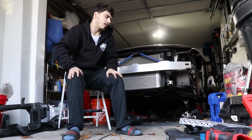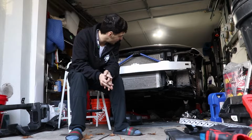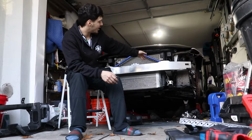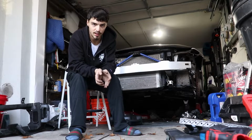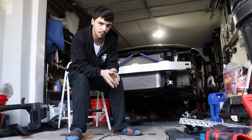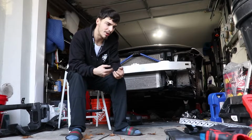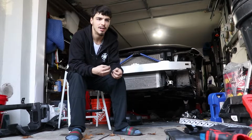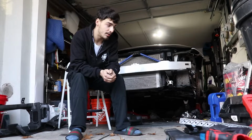You know, it's weird. I don't like that rattling sound. Discovered a leak somewhere on the driver's side engine area. I'm worried that my head gasket's gone as well, which also could be coinciding with the turbo seals and making that smoke. It's really one of the two technically. Like for the common issue, it's either one or the other for the most part. I'm not getting any rod knock.